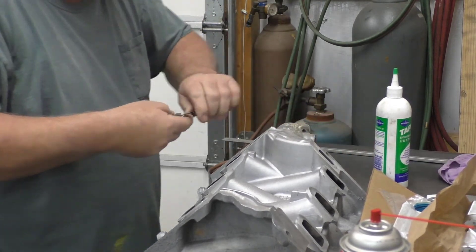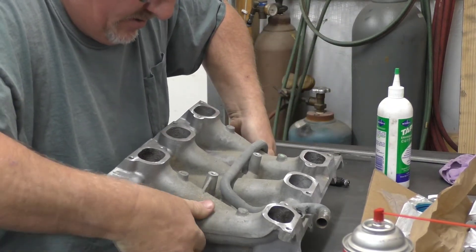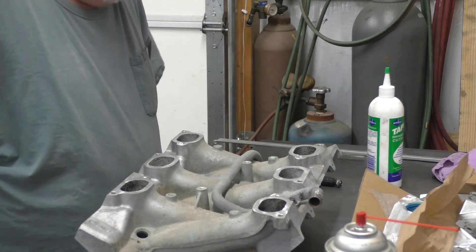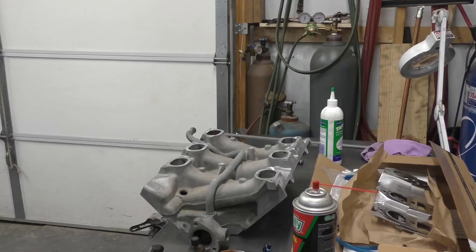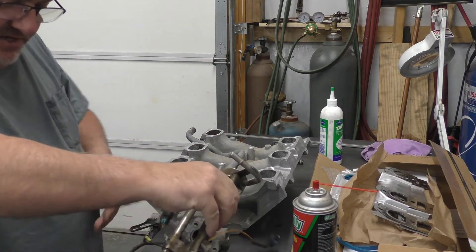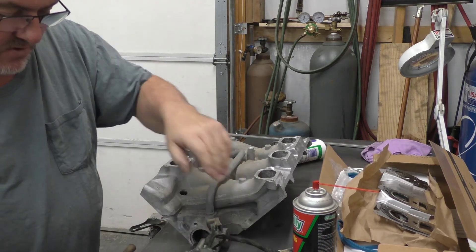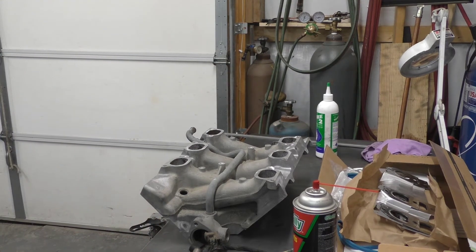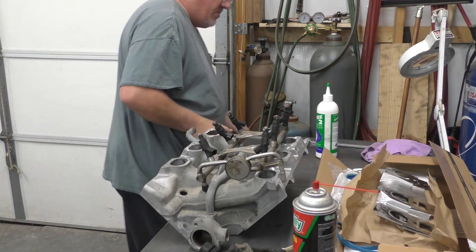All right, 5,000 is a no-go. I'll go ahead and build this. Injectors are lubricated up already — I've done that off camera, got grease on them so they'll slide in better. The holes have been cleaned with a brush. I'll flip that around — thermostat housing to the back. This is the rear, so that's how this is going to go on.